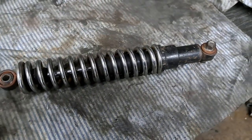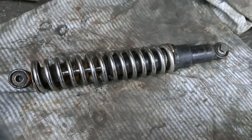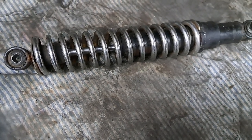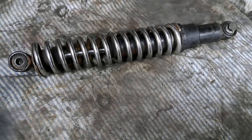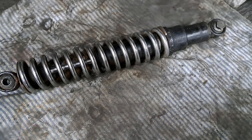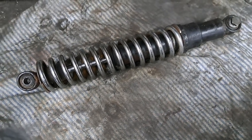I thought I'd get started with the shocks. Here's before. I've got to get this one apart before I get too serious with the other one that I've taken apart. There's no point in cleaning these up if the actual shock absorber is gone. Make sure the shaft is in good condition — you don't want to see too much rust on that shaft. If you do, clean it up, make sure it's smooth, polish it up well, grease it so it doesn't hurt the seal. Once you get the spring off, you can compress the shock and pull it out. It should compress fairly easily, but it should provide reasonably stiff resistance when coming out. Otherwise, the back of that bike will just bounce up and down.